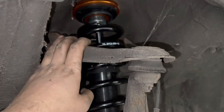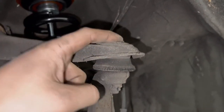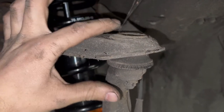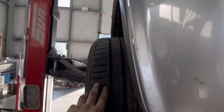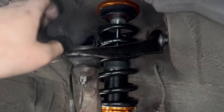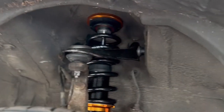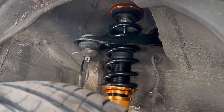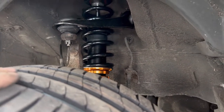I bought some adjustable camber arms, so they might fit differently — this ball joint here you can slide back and forwards to bring the camber in. We've still got this major camber issue here, obviously because of that bent hub arm. I've got a new hub coming, and then adjustable camber arms to go on front and back which should bring that back in a bit. I've just raised it a little bit and I'm going to give it another drive to see if it clears.